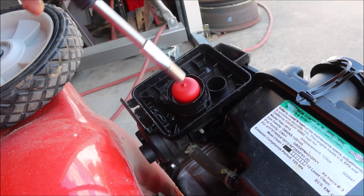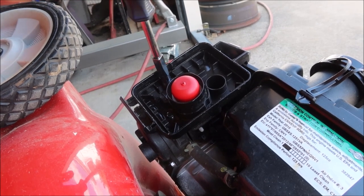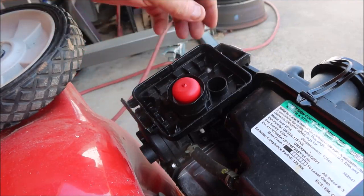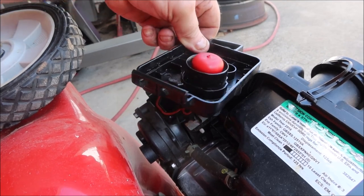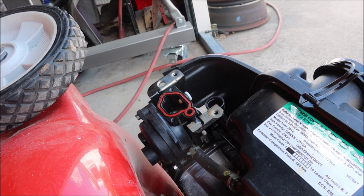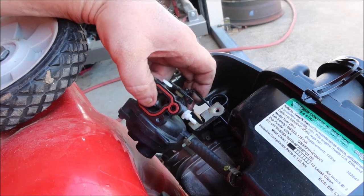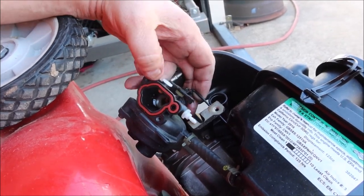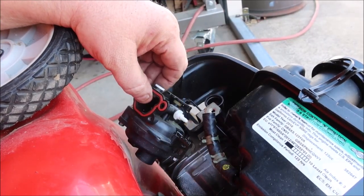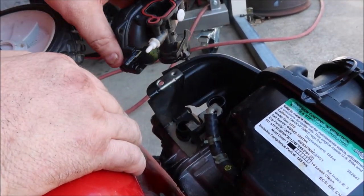You've got a couple of different sizes to get this air filter base off the carburetor. The bottom screw and the side screw are 7mm, and the other screw on the outside is 8mm. Get those off and lift the whole air filter slash primer base right off. There's a PCV tube connected to it that slipped off with no problem. The carburetor just slides right up — it's only held down by the air filter base. Disconnect the fuel line, then disconnect the throttle linkage, and the carburetor is out. Just twist it free.